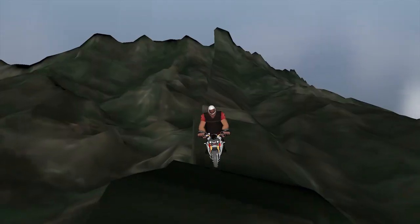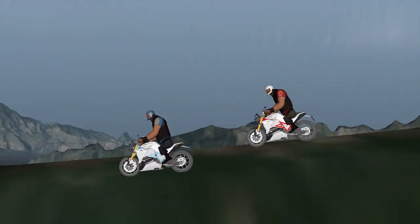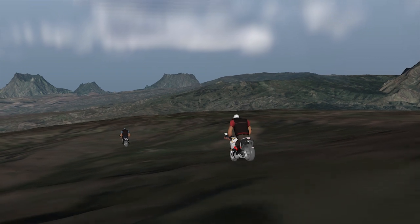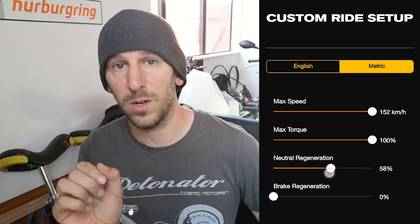Going back to the mountain example: if instead of using regen on the way down you just coast the whole way, your momentum from coasting might actually take you further than if you'd used regen. But that's debatable — if you have to stop anyway, you might as well use regen and charge the battery up. The most popular setup among electric motorcycle riders seems to be no regen when off throttle so you coast, and then 100% regen when on the brakes — because you can half-pull the brake lever to trigger the regen before using your brake pads, kind of like half-pressing a camera shutter button to focus.